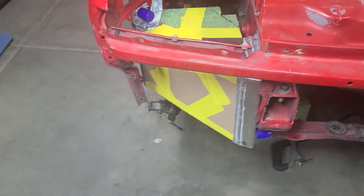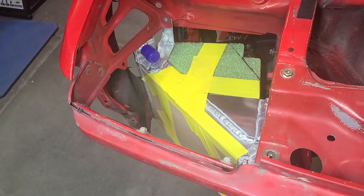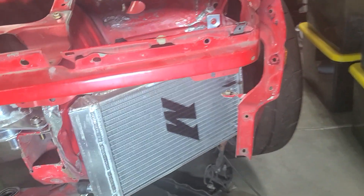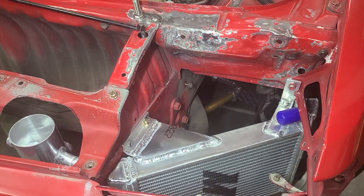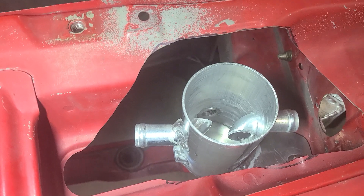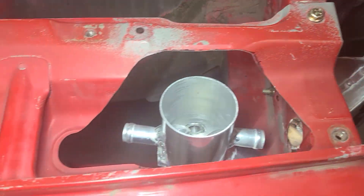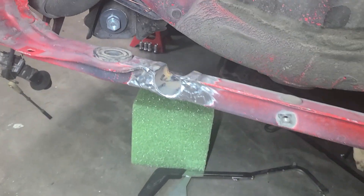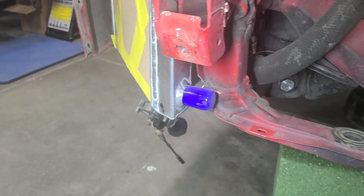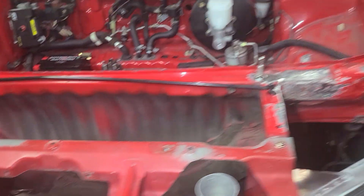Coming back to the front — since the engine is in the middle, getting air-to-air cooling for an intercooler is a little challenging. I've got a pair of additional radiators, and these two are going to be used in conjunction for the intercooler. There's an incomplete swirl pot setup that will help get air bubbles in this auxiliary cooling system up and out. I've notched things in preparation so each cooler will come together, they'll tee, and the coolant line will go through there, then back to the pump to the intercooler and loop back.